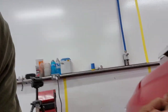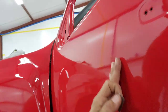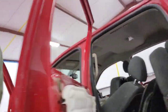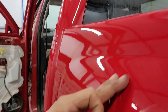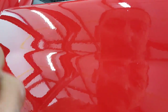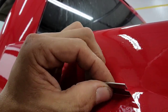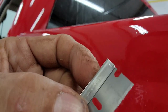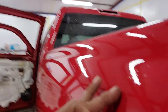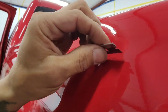So this is a blade. What would you do with this? Let me find a dirt nib — what about this door? Look right here, there's a little dirt nib. You can't really see it on camera, but you get the blade flat — it needs to be completely flat — and just scrape it like that. That's dangerous because the corners of the blade can sink into your brand-new paint, so obviously you don't want to do that. But there are some dirt nibs right here — you don't really feel them, but you can see them.